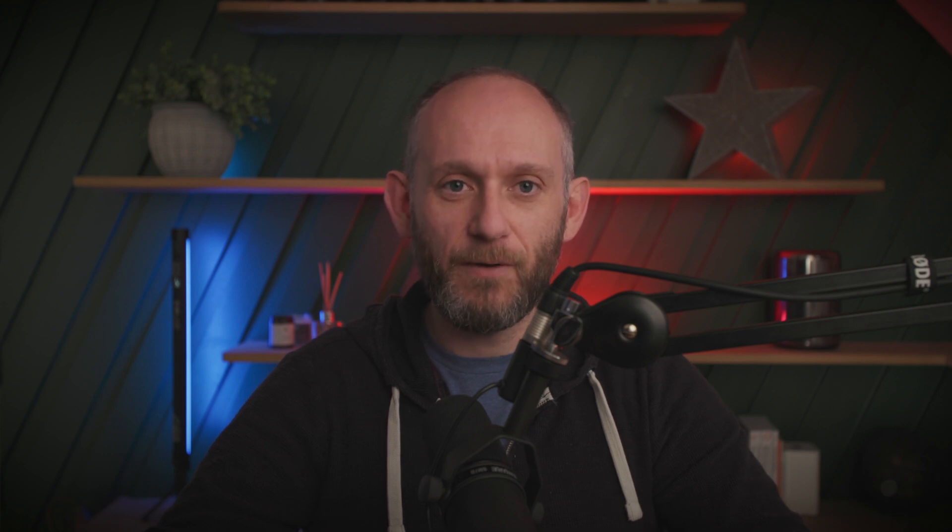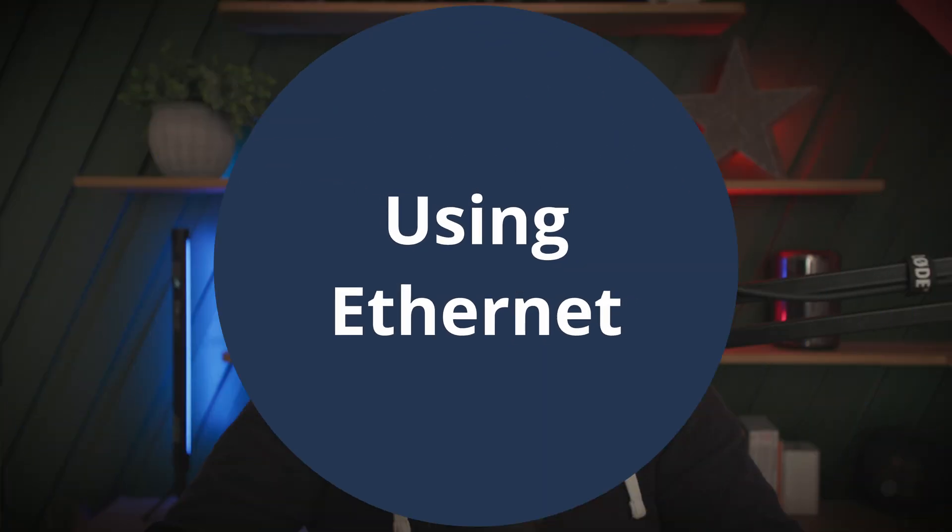The tethering solution is the best approach for older Pis and also the best approach for cell phones, since the Pi can satisfy their power draw and share the internet connection. Obviously for tablets you won't be able to satisfy the power draw, so you might want to look to the solutions at the start of the video. If none of the solutions so far fit your phone, tablet, or single-board computer, you can likely fall back on using a standard Ethernet cable to connect the devices.